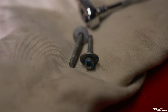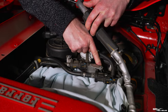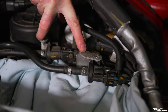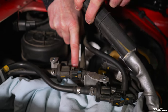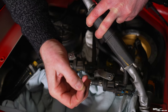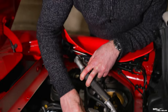This is just loosely mounted and bolted to the bracket. Remember these pipes are part of the EVAP system, so go carefully and just move them to provide access. You can see how the purge valves are held on to this bracket — there are stems of metal coming away from the bracket where the purge valves clip. They're rubber mounted because these make a nasty clicking sound when worn, which is why we're replacing them. The rubber mount fatigues and hardens over time, which accentuates the clicking.